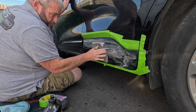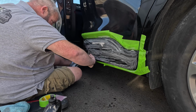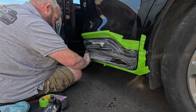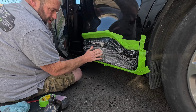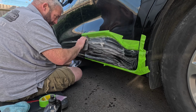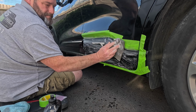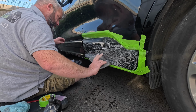And yeah, just a little bit of water-based degreaser on Scotch scuff. You can use normal water. That was right beside me, so I just used that. And give that a good old scrub up, mat it all off. Get it ready.